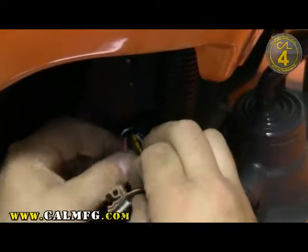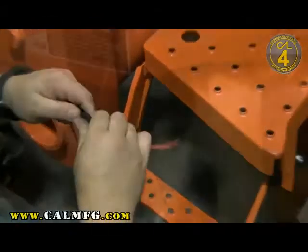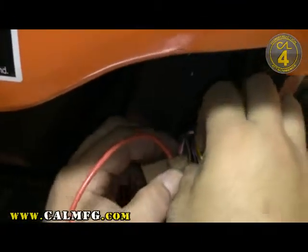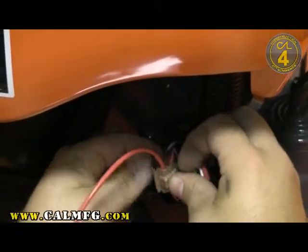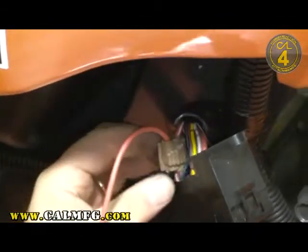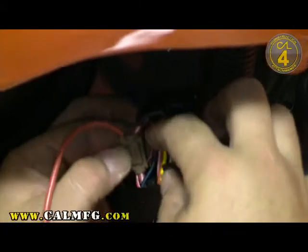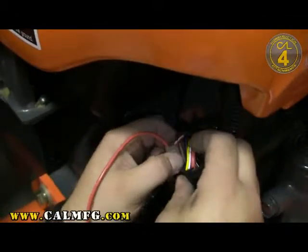I'm going to shut the power back off. We're going to use a side-by-side splice connector to make this connection. When we check all these kits before they go out, we verify that they have a 20 amp fuse. We're going to put that side-by-side splice connector on and insert the fusible link into the only other vacant hole on the side-by-side splice connector. When you pull this across, it's real important to be sure you only gather the wire you're working on and don't get any of the other wires. You should be able to get it partially closed by hand, then use pliers to make that connection. You need to clamp on the center of the side-by-side splice connector to make sure the metal clamp inside actually penetrates the wires. Check that to make certain it won't come out — the clamp connector is locked.